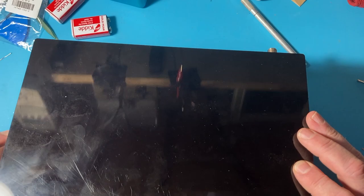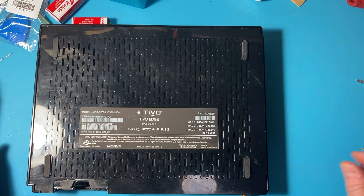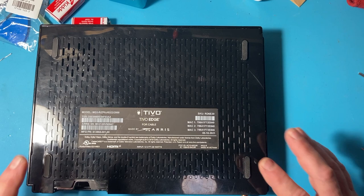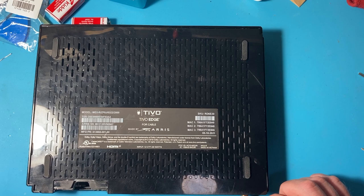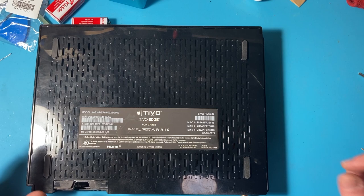You can take a look at this — it was made in May of 2021. I put in a bug report to TiVo on their website and got back a canned response that was completely non-responsive and idiotic. So I called them just now, and the gal was actually very helpful. She made me plug it in with everything disconnected. And I know from some threads on Reddit that people have been able to make these things boot by disconnecting the wifi. She had me not have a cable card, not have coax connected — just plug it in with the HDMI cable. And it did the same thing. The hard drive's probably the issue — it could be a power supply, but I'm assuming the hard drive.